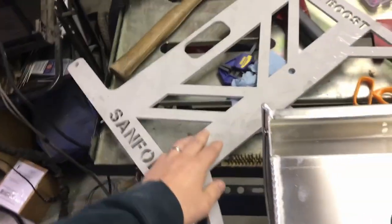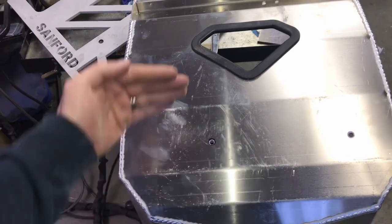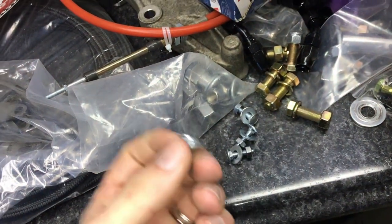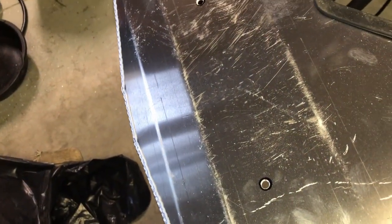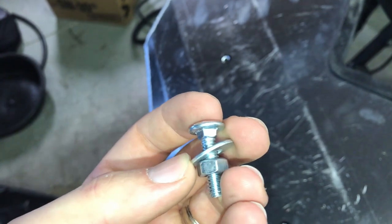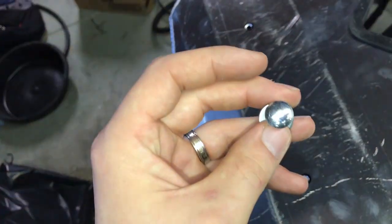What I did was I basically lined up this guy and centered it on here after I test fit it in the car to see how far in and out I wanted to go, and then drilled the two holes. For the hardware I'm going to be using these carriage bolts, at least for now - that way the carriage bolts on the inside where I'm sitting, I won't really feel it with the padding. I've undersized the holes so that it will grab the square on the carriage bolt, which stops it from spinning when you're turning it.